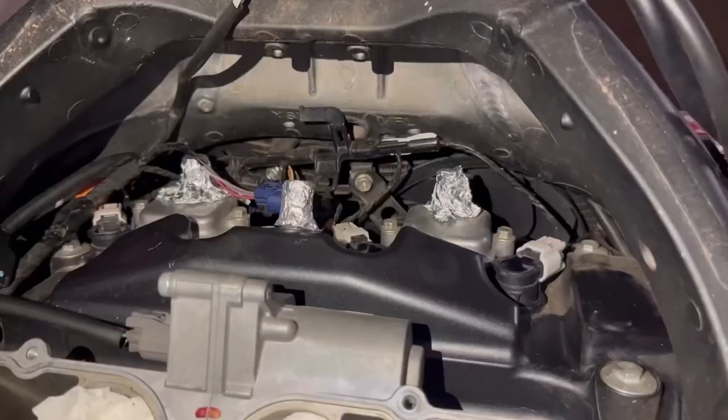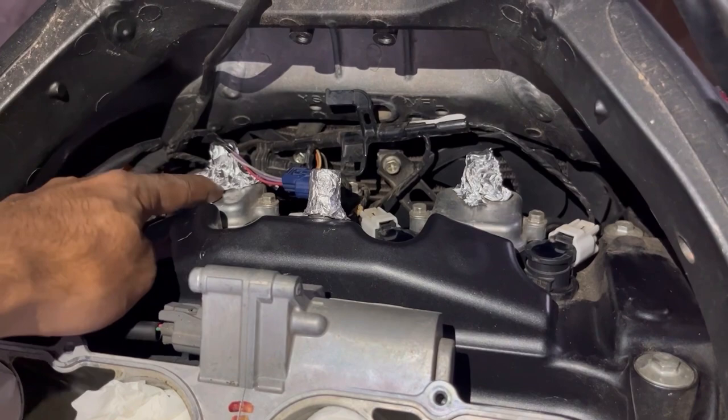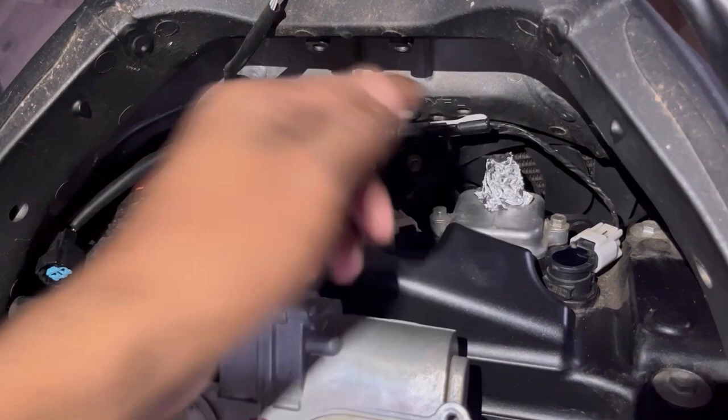Yeah, guys, I wanted to bring up one last thing before we jack the bike up to tighten the steering head. We did a smog delete on this bike, and we're going to be doing pretty much a free smog delete, as we're not going to be buying new block-off plates. We're just going to get a hose and connect the hose from here all the way across to here, and there goes your free smog delete. So instead of spending 60 to 70 on some plates, we're just going to connect a hose from here to here, and you call it a day.